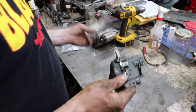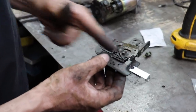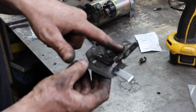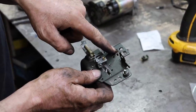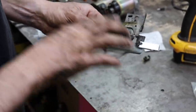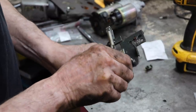This thing was going back a little bit too far and this little gear wanted to jump out, so I needed to add some kind of limiter or stop to it. There was a little hole here so I went ahead and drilled out that little divot and put a screw in there, and that keeps this from going back too far — because that would have been a problem.